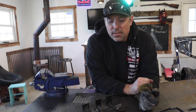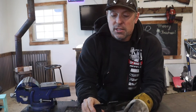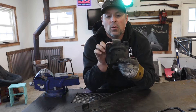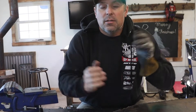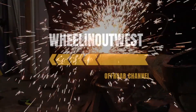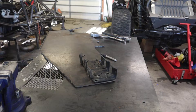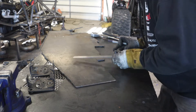I'm continuing work on my rock crawler chassis build, working on motor mounts today. I've got the old motor mounts here and I'm using them as a template for the new ones. I've got some 3/16ths inch plate — I'm going to set the old motor mounts on it, cut out the squares, use the old holes as a guide for the new holes, and start with a nice flat piece of new plate that I'm going to end up welding my chassis tube to.